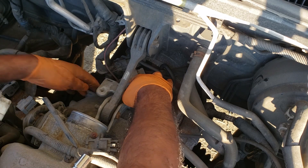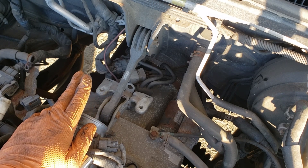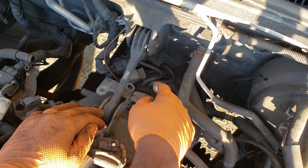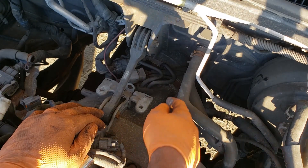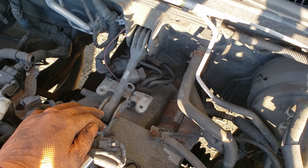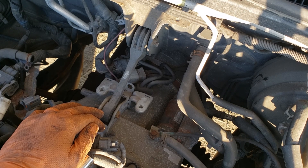Next step is to disconnect this breather tube or valve. Most Subarus are pretty much the same thing. There's also another 8mm here on the intake. Once you get that loose, there's going to be two hoses like this on either side of the intake — just yank them off, they're really easy. Then get the intake out of the way. That clip there just unclips; be gentle with it — there's a little tab in there you press down.